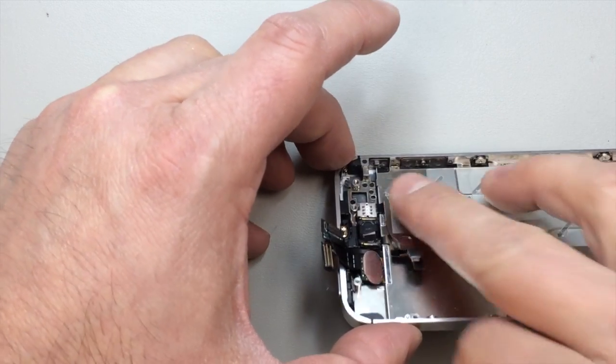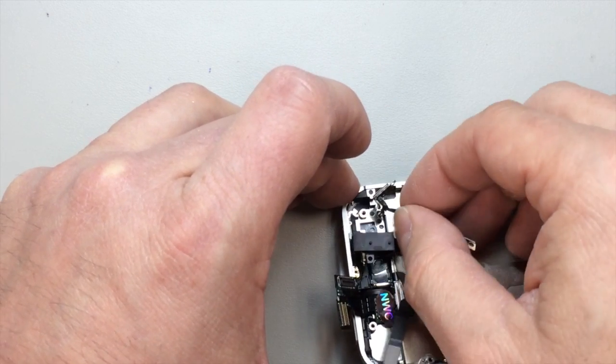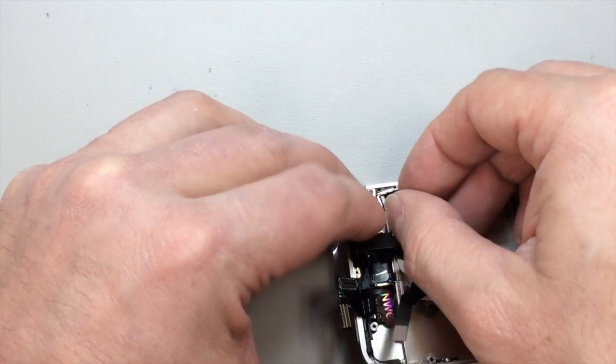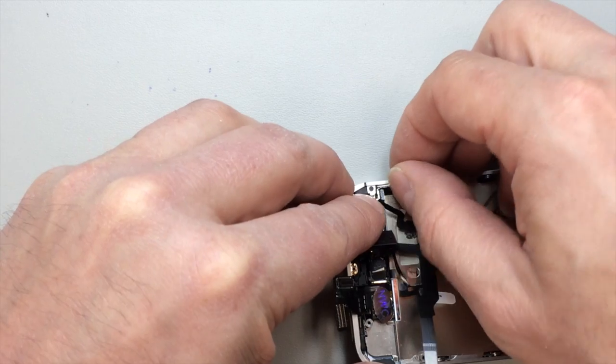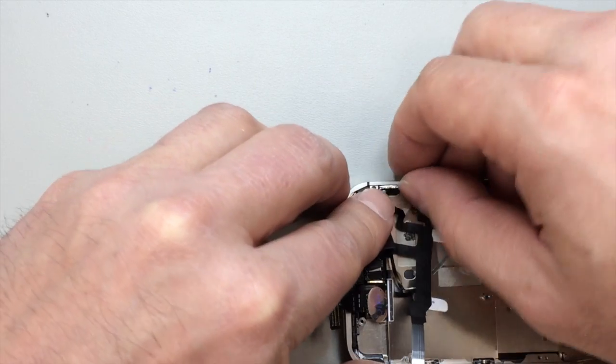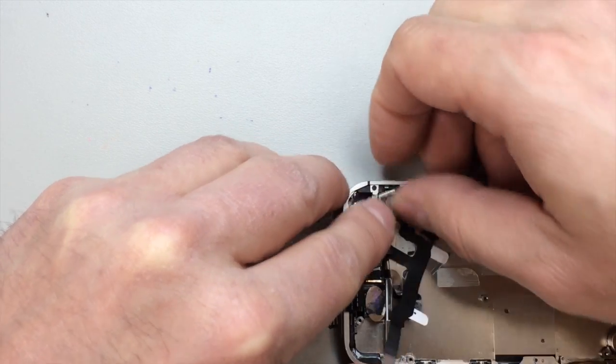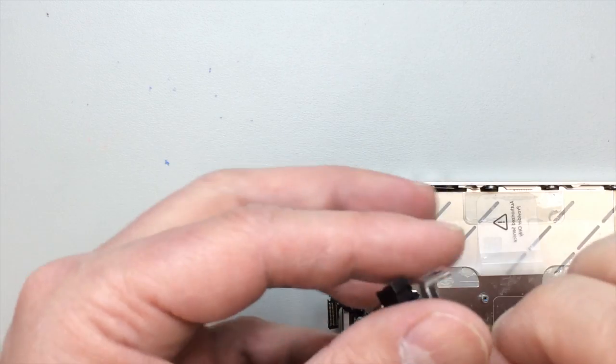And you want to have your power button in the down position towards the table and the same with the switch itself so that they match up. Otherwise, you're going to have problems. And as soon as you feel that going to the correct position, check on the outside, make sure that it is clicking back and forth. And if it is, I would recommend you put a screw in there as soon as you can, just so you don't have to hold that in place.